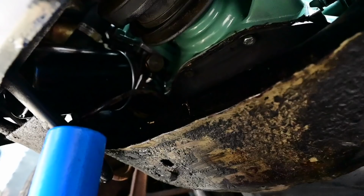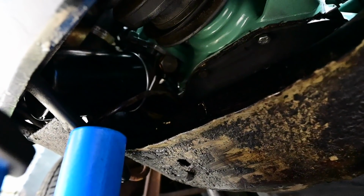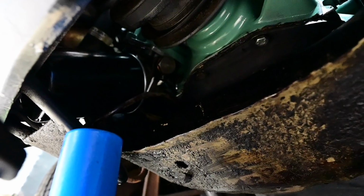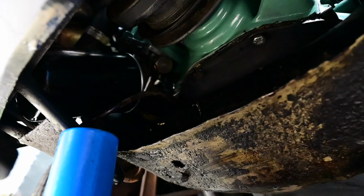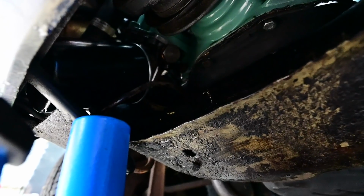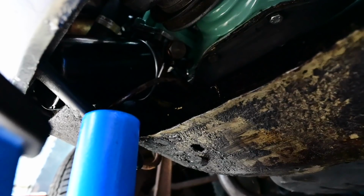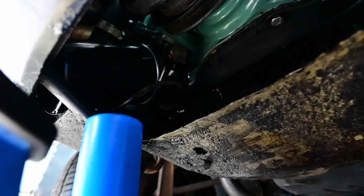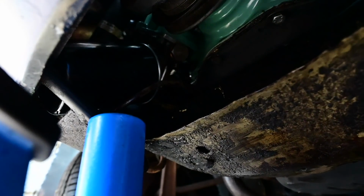So what I've wound up doing is double stacking 2 paper gaskets in between the cover plate and the pump itself. I managed to lose the footage of this, but basically it was a massive faff involving rubber bands and screws half pegged in and about an hour of fighting gravity. So now I've got a pump that turns. However, I'm now concerned that because I've got too much clearance, it won't be throwing up enough oil pressure. This is a new problem, but we'll see how this goes.